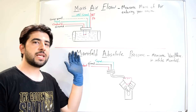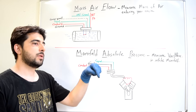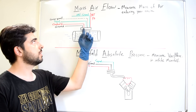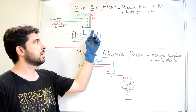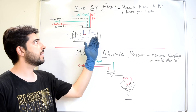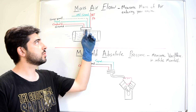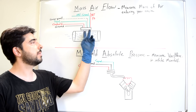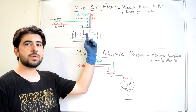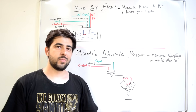As far as how you test the mass airflow sensor, basically the same principles. Get your multimeter, put it to ground, then check for voltage first. You should have 12 volts for your MAF sensor, and if you have one with an inlet air temperature sensor, you'll probably have 5 volts for that so you can separate them. Then switch it around and find your ground, and the remaining two wires — on a 5-pin connector — one is for the temperature sensor and the other is for the mass airflow sensor. Or you can always look up a wiring diagram in your car's repair manual to find which wires are which.